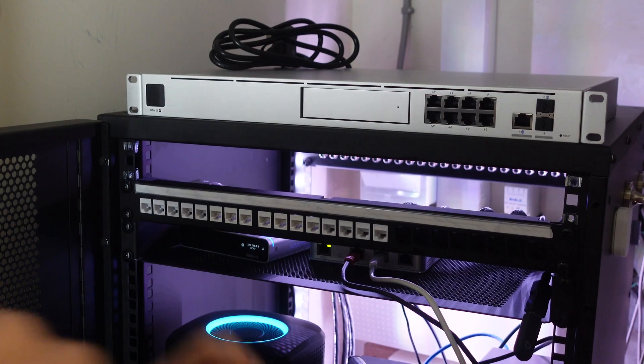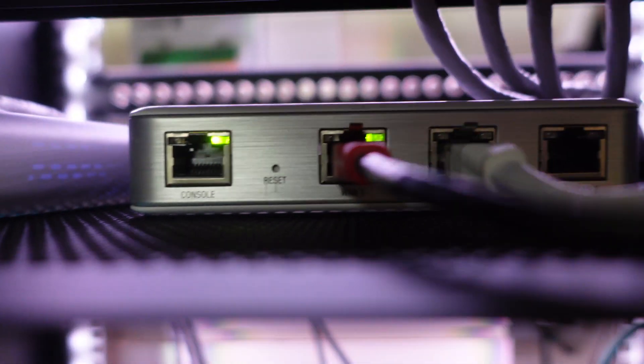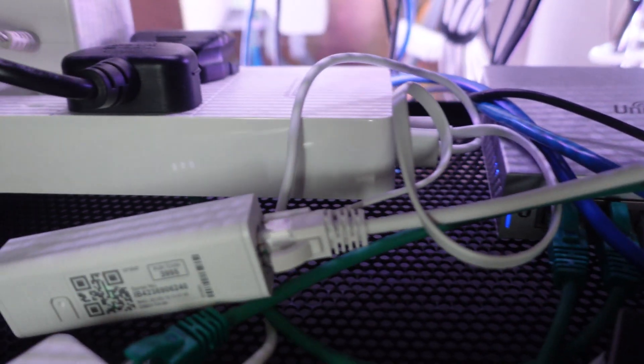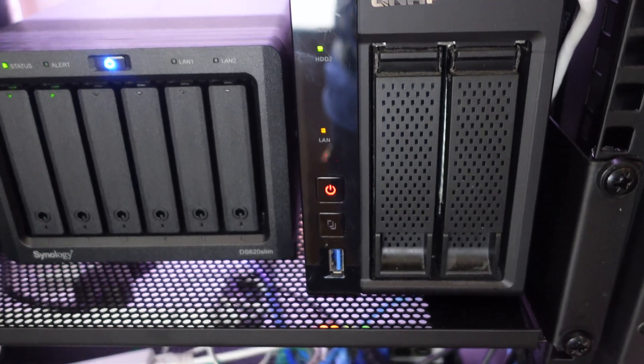In addition, get yourself a couple of rack shelves. Don't put stuff straight on top of servers or other rack-mountable equipment because the day you want to move something out, everything falls down — so please get yourself some shelves. The shelves I got are perforated ventilated shelves: the 1U occupies three holes, and the 2U is bigger for heavier equipment and allows bigger equipment at the back. On my 1U shelf I've got a Home Assistant server, a Philips Hue bridge, a Zigbee bridge, and a Tado bridge. On the bigger 2U shelf below I've got my QNAP NAS, Synology, and my AMBER NAS.